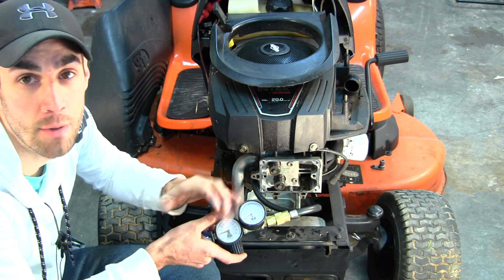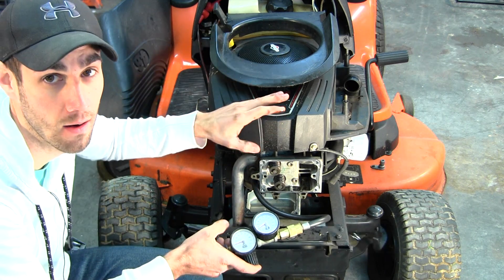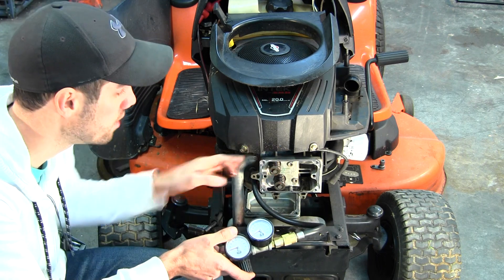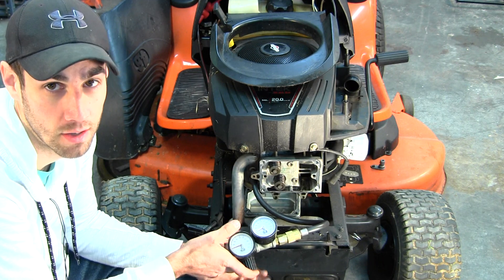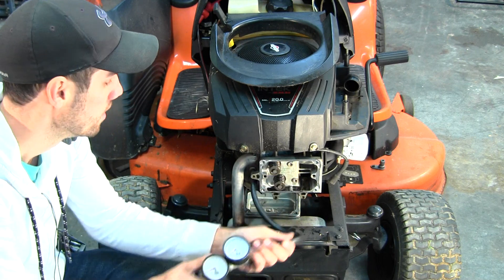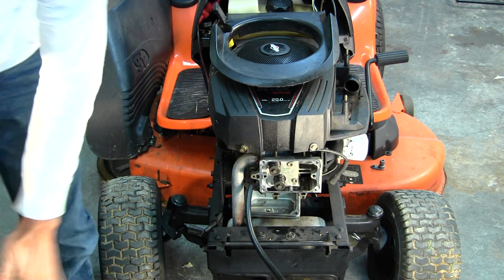You need to verify how much leakage you have. If you plug this up and had 90% retention — meaning only 10% leakage — you're probably fine, even if you hear a little air. It's not the end of the world unless it gets worse or you hear air around the head gasket. A blown head gasket needs to be fixed whether it's leaking a little or a lot. In our case we have 80% leakage and I can hear it right there. So let me plug my smoke machine up and verify that it does have a blown head gasket.